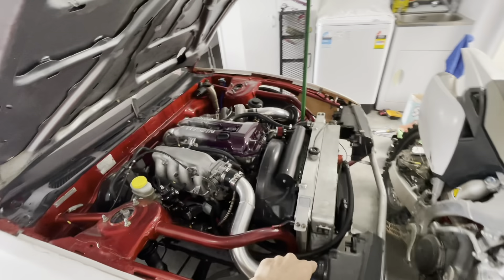It's never a bad thing to make more boost, but obviously with the stock bottom end — the DE makes about 140 to the wheel and now it's making 300 plus at 6000 RPM, which is crazy. We're just going to change that gate out, do a new flange and things like that, and we'll be back for a retune in the next couple of weeks. We'll definitely be filming that too. We have the tube front as well.